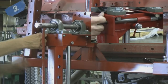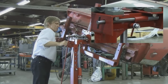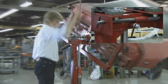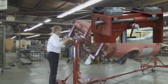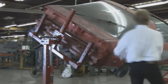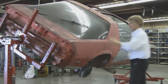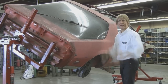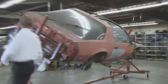Well, you've got an indexing pin system that I can pull out and lock into the next position. That spring-loaded lock-in system is somewhat balanced, but not perfectly balanced — but it will allow me to do the job. I've already moved this car 30 degrees. If you want to work on the top of the fender, the lighting in the shop is usually pretty poor. Operators are all different heights — guys are going to be 6 foot tall down to 5 and a half feet — so you want to move the working height so it's easy, great on their backs.